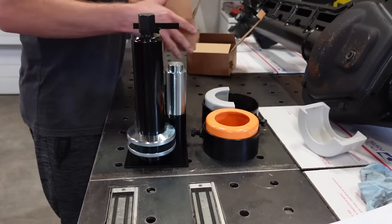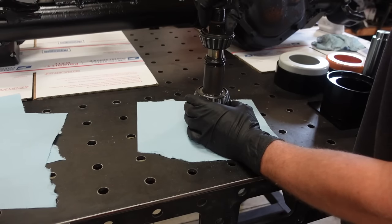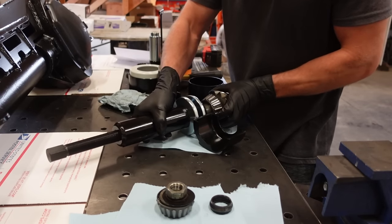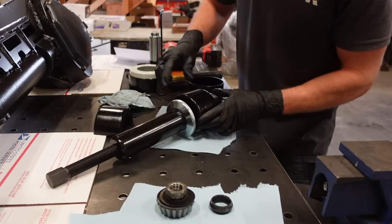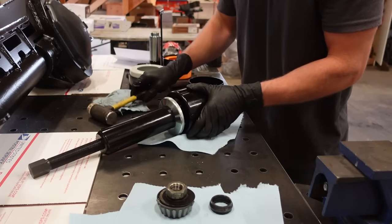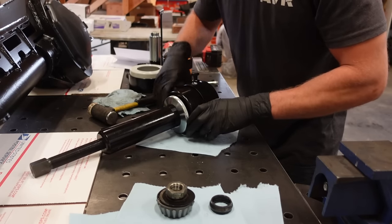Now, what I did is I bought a pinion bearing puller, and it's going to help me out tremendously with this job. If you guys want to check out any of these tools, I'll definitely link all of it down in the description box. So what we're going to do is pull this bearing off. We got to put the shim from this bearing onto the new pinion.